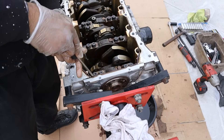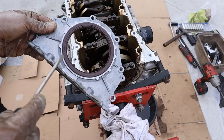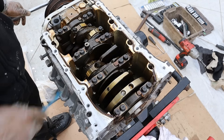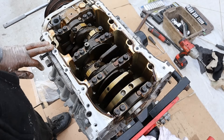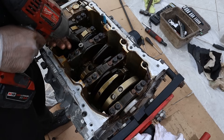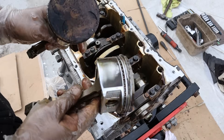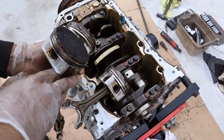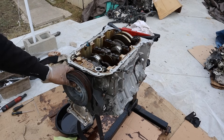Removing the upper oil pan — not looking too bad in here either. Now I'm going to remove this rear main seal. As your car ages, this seal is going to start to leak and you'll see oil coming out between the engine and transmission; you've got to dig out this rubber seal and press in a new one, and of course you have to remove the transmission to do that. And here we have the heart of the ubiquitous 1MZ-FE engine. One of the main characteristics of the 1MZ is that it's very smooth and quiet — the same cannot be said for its successor, the 3MZ engine. I'm going to remove the connecting rod caps — these take a 12mm 12-point socket — and the connecting rod bearings look beautiful. Let's take out these pistons.